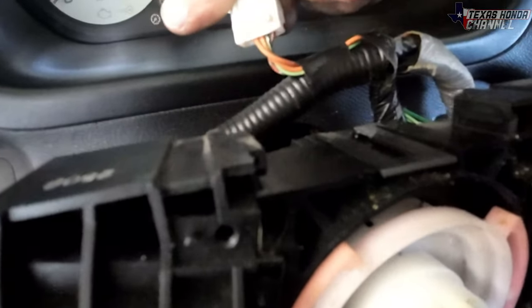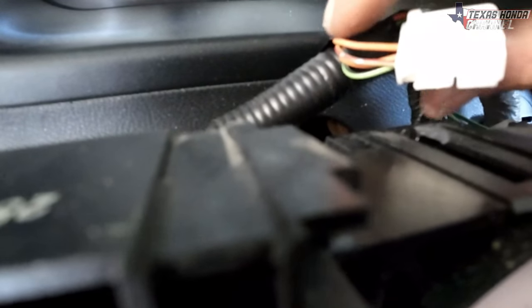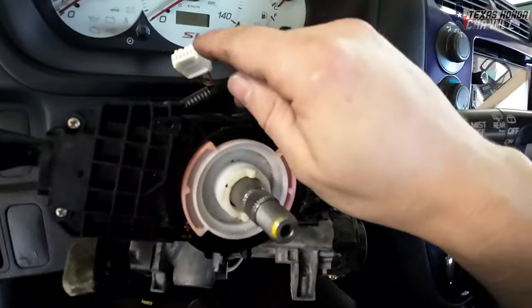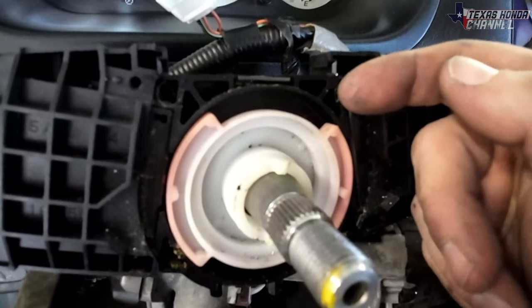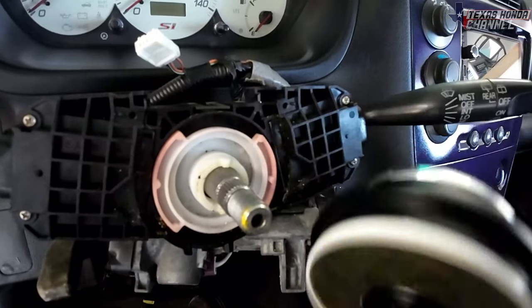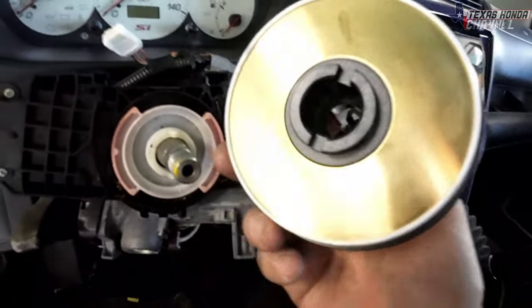On this connector here there are two orange wires, and you're going to want the orange wire that is just solid orange — no other color on the wire. We're going to tap into that — that is the horn wire. Once we tap into that, we're basically going to use one of these holes and have a piece of metal coming off of it which will make contact with the back of this and activate the horn. It'll basically be rubbing right here.